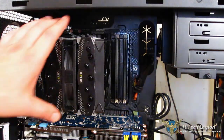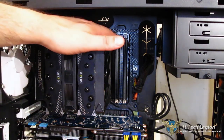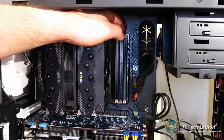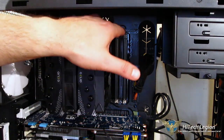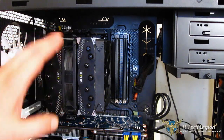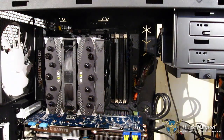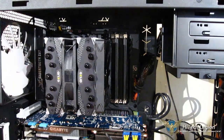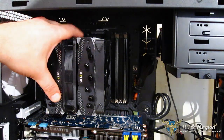Installed in the case with the fans in, the Gelid Black Edition is a good looking cooler — dual tower with the slim fan in front. It does overhang the first RAM slot a tiny bit, not quite to the halfway point, so you may or may not fit taller RAM in the first slot, though the other three are fine. If needed, you can move the slim fan to the back, opening up all four RAM slots with slightly less cooling. The installation itself is not incredibly difficult, however the quality of the components in the kit felt a little lightweight for a cooler in this price range, and the fan clips were incredibly difficult to work with once the cooler was installed.